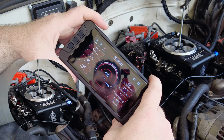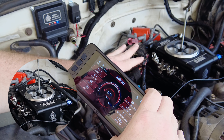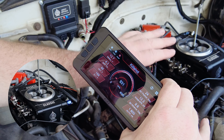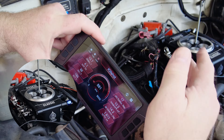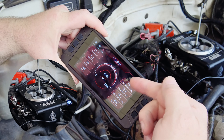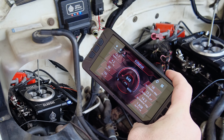You can also cover that hole up and adjust it to about 50 to 100 RPM lower than your target, zero your TPS, and you should still be in a pretty good range when you're done. If you're not using timing control — if you are using timing control, you lock it out in a handheld and do a similar thing.